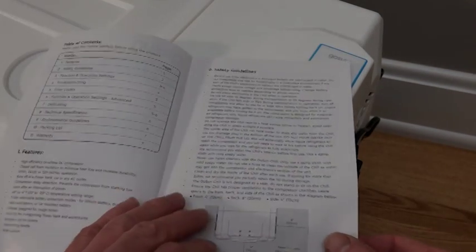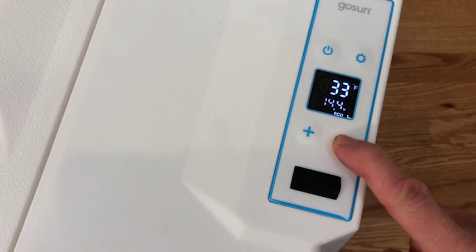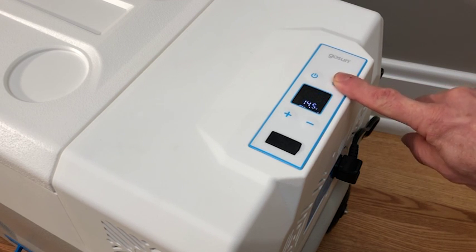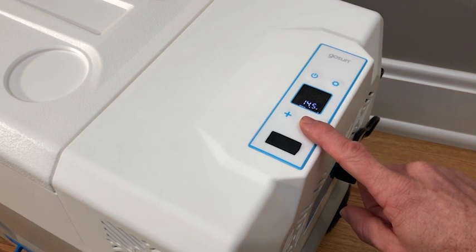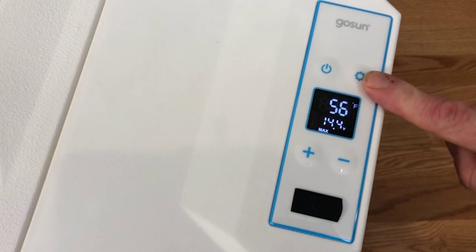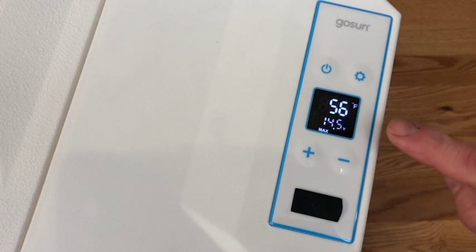You're going to want to read the user manual first. Anytime while the Chill is turned on, press the up or down buttons to increase or decrease the set temperature inside the Chill. With the Chill plugged in but not turned on, hold the setting button until you see E1 flashing on the screen, then press the setting button again and continue until you get to E5. Then press the plus or minus button to change between degrees Fahrenheit or Celsius. With the Chill plugged in and turned on, hold the setting button until the current battery protection level setting starts flashing on the bottom right of the display, then press the setting button again to change between H, M, and L. The setting will be saved after 3 seconds of leaving it alone.